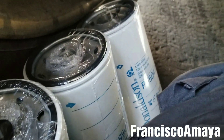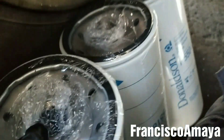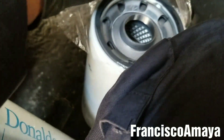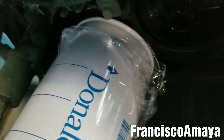All we have to do is check that there are no seals left on the housings — there are none. So we can install the new oil filters. Remember, there are three oil filters but one of them is the bypass. How you identify them: the regular oil filters have a small orifice and the bypass has a larger orifice. On original Volvo filters, they also have the word 'bypass' printed on them, so that's how you know where to install the bypass filter. Now we're going to install them.